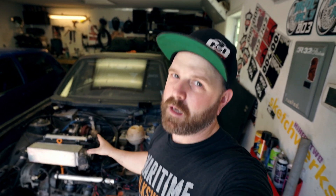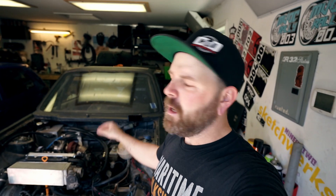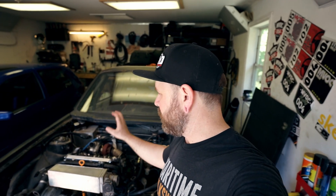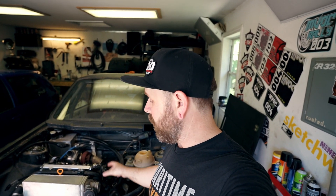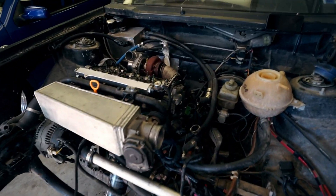Fast forward probably not even two hours from the start — coming in here, jacking the car up, getting everything ready to drain the fluids, take off the downpipe, dump tube, all the intercooler piping — pretty much everything to the point where I'm at now. I took the head studs out so when I lift the head off I don't have to come all the way up, because I left the turbo, manifold, and intake manifold hooked up — I want to take it all off as one. I'm just waiting for a friend to come over to give me a hand lifting the head off. Everything's just disconnected now, ready to take it off and see what's wrecked.